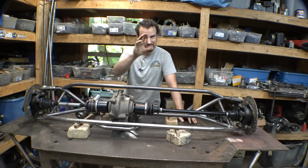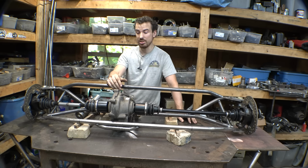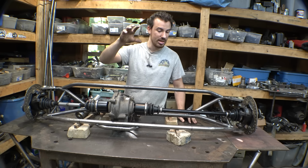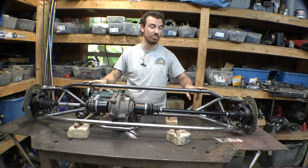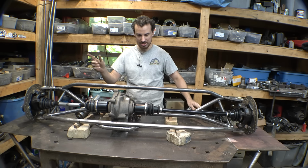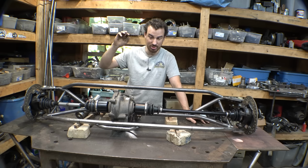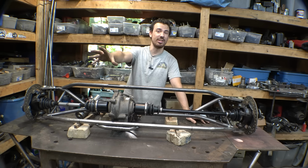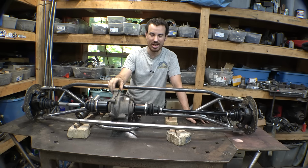Now, next video of this project, we get to hopefully finish this thing. There's not really that much stuff we need to do. We need to, like I said, figure out where the power steering and rack and pinion are going to go. We need to add the shock mounts, the bump stop mounts, the other mounts for the forward-link suspension, finish the frame tubing and cross bracing, all that kind of stuff, and then disassemble it, weld it all together, weld the CV axle, and then this thing's pretty much done. And we can install it on this thing and finally see what this thing looks like with all 4 32-inch tires on it.